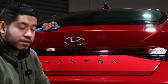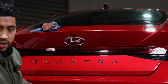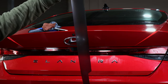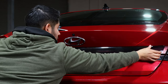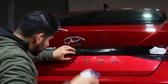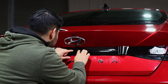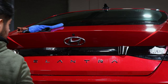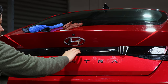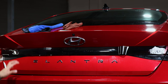Now we work on the top piece. It's pretty simple — align it towards the middle and work your way out. Add soapy solution, wet it, and place the tint. To help it stay in place in the middle, add some tack solution. Make sure it doesn't overstretch so everything stays aligned, then tack it down. Add a little heat to make sure it's secured.